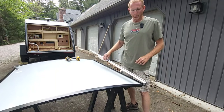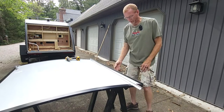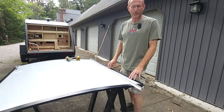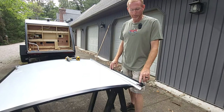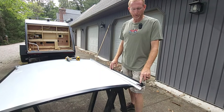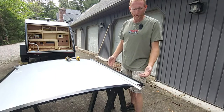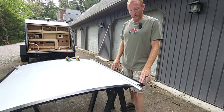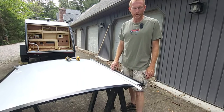I'm going to drill these rivets off. They've got three rivets on top and about five rivets on the lower section attaching this to the door. All you want to do when you drill these pop rivets off is drill off the head and then punch the tail down through into your work surface below, and that will allow it to pop off. You don't want to oversize those holes any more than you have to. So we're going to drill those off, get this lower end section off, and then go about putting the new lower hinge section on.